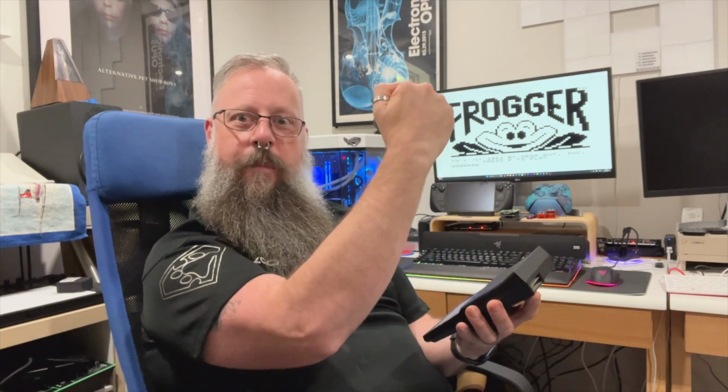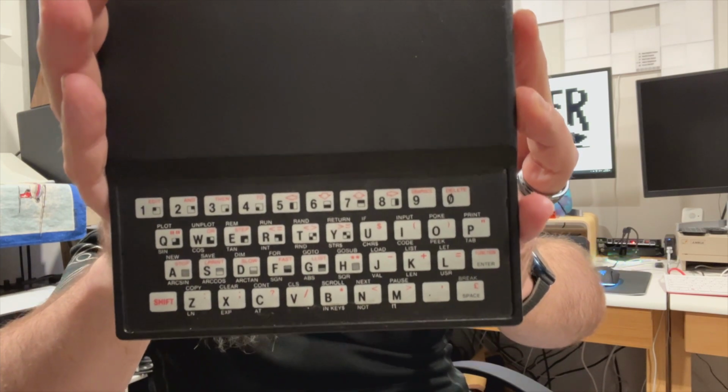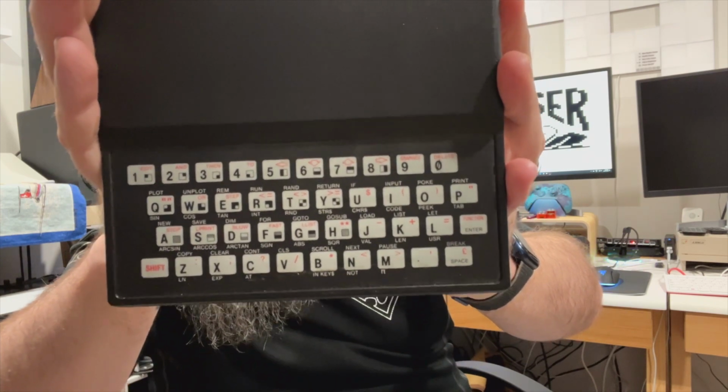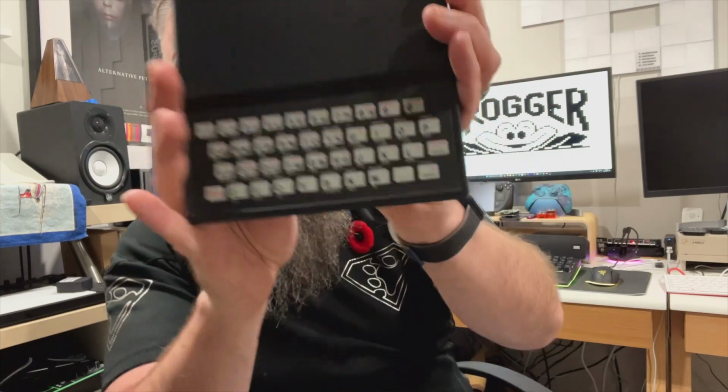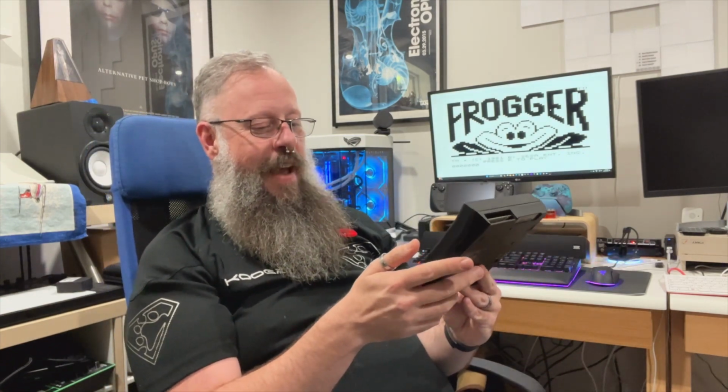So you actually had to use a scroll command, and then it would scroll from the bottom up. It was quite interesting. The other thing is, if you look at the keyboard, it has all the commands on it. So, for example, would I hit L for load? No, that is let. J is load. So to load Frogger, I hit J and then shift P P for quotes, because quotes were on the P key, right? Yeah, it wasn't shift 2. Shift 2 was and. So yeah, very quirky. You had to either memorize or remember where the commands were.